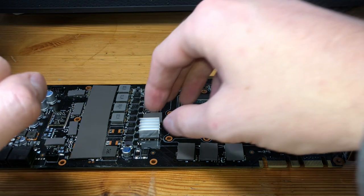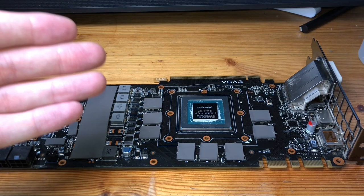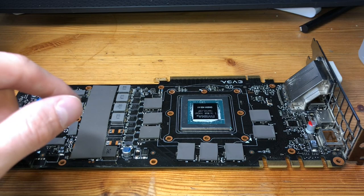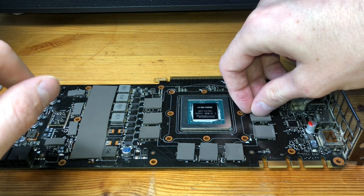Be mindful of your graphics card and what the layout is within it. So again, this is a 980. However, if you're using an AMD or any other PCB design, you might be having a different setup. Don't necessarily need to do the heatsink applications. So to get it started, I'm gonna take off the thermal pads off of these bad boys. They'll come off.